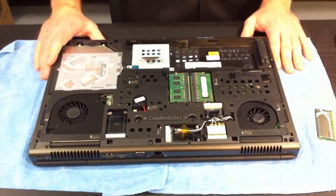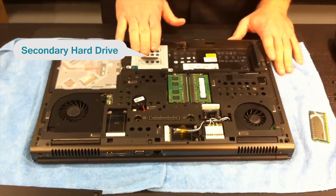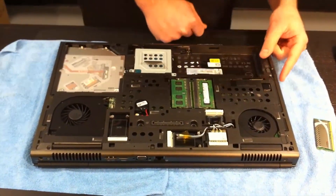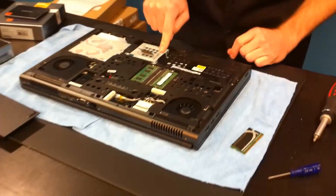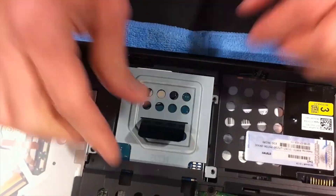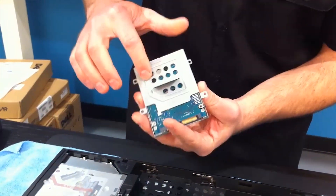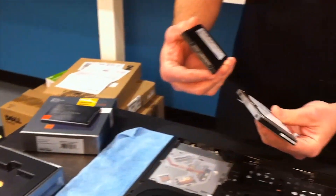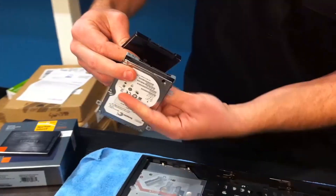This is very similar to the 6500, but there are some key differences. Same approximate location of components — you've got your secondary hard drive and your primary hard drive under here. The primary is no longer directly accessible through this side; they made a huge improvement and it actually comes out through the side now. I took the liberty of taking out the four screws that exist here, here, one below here, and there — four total to remove the secondary hard drive. Once you've got those four, you can simply pull the tab and then up and out. You'll notice this cradle — we'll unscrew those four black screws and drop our two-and-a-half-inch solid-state hard drive into that same location, keeping in mind the same location of the SATA connectors.